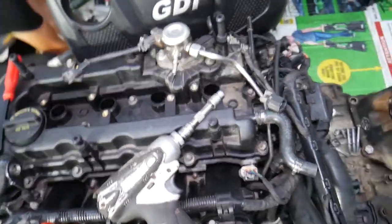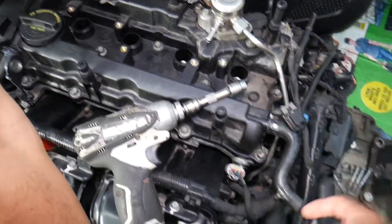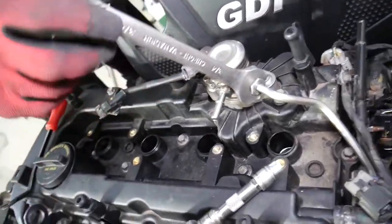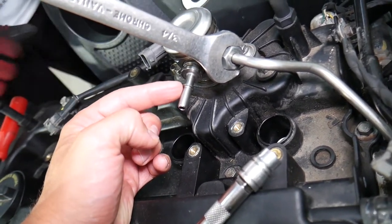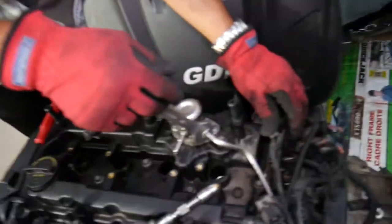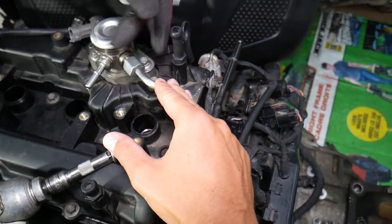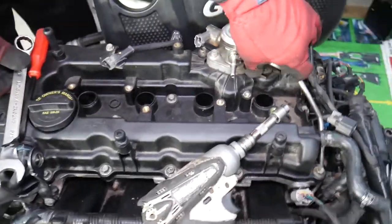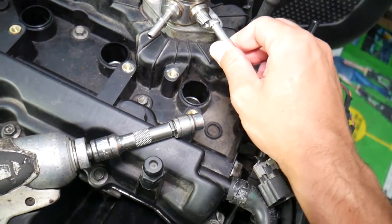The ignition coils came out. Right here you have the intake hose - we have it removed, but you can disconnect from the intake hose or from right here, it's up to you. Next we'll disconnect the fuel line. You have the low pressure fuel line - if you don't know how to disconnect it, we have a special video on our channel. Then you will probably be leaking fuel, so carefully disconnect that line as well. That's the high pressure fuel line.